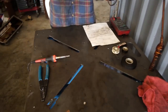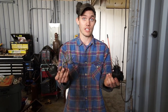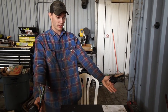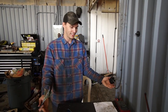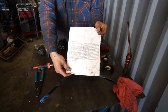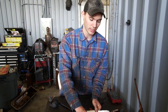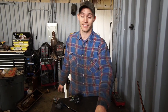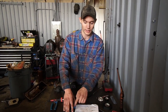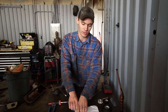We're going to give you a rundown of the harness adapter to go between the E36 harness and your factory E30 harness. You have to have one of these — you can buy them pre-made but they are expensive. Ten minutes at a junkyard and a little bit of soldering equipment is all we've used so far — we're talking $10 to $15 worth of stuff. First, get one of these wiring diagrams — we're going to link this to you. It tells you the pins, the wire colors, and what they do, and then what to hook them to. And a word to the wise: these wire colors can be wrong. The pins will be correct, so you always want to use the pin number — don't go by wire color. You might end up in a terrible situation chasing your tail on electrical problems.